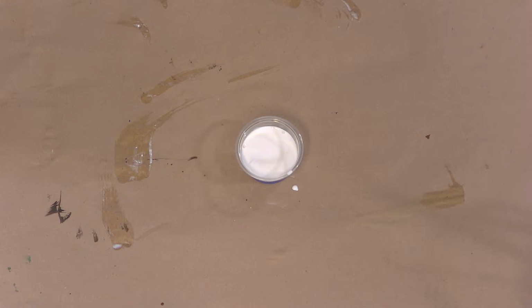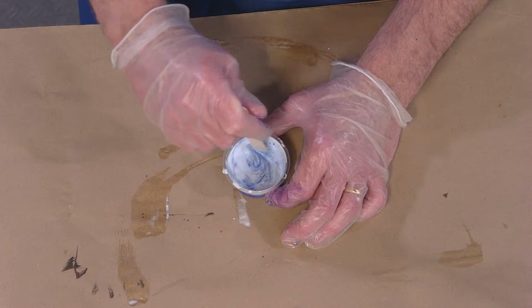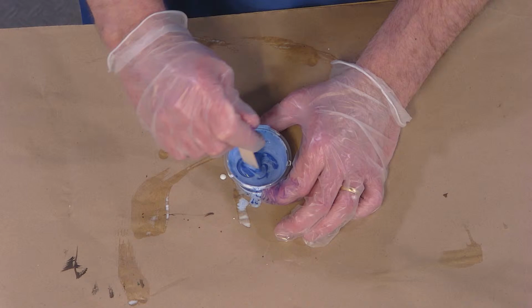So it's really important, the difference between the adhesion promoter and the flex. The adhesion promoter you use by itself when you apply that to a rigid surface. The flex additive, you have to mix it with the paint, and then you would apply that. And you don't mix up using the adhesion promoter and then using the flex on a piece either. So don't do that either. That's not what they're for.